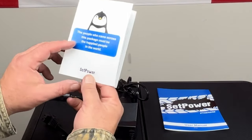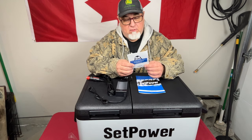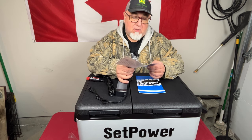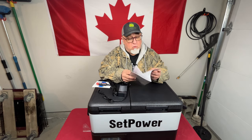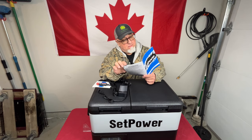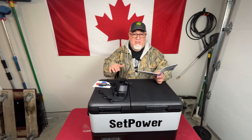It's got a three-year warranty on the compressor and a one-year warranty on other parts — pretty standard. You're entitled to replacement or a refund for a major failure, or compensation for any other foreseeable loss or damage. The manual seems pretty straightforward — we're not bombarded with 13 pages of warnings. Importantly, don't start this up for at least 24 hours after it's been upright. If it was shipped or placed on its side, wait 24 hours for the compressor and fluids to settle before use.